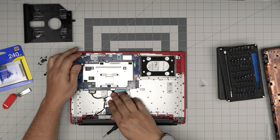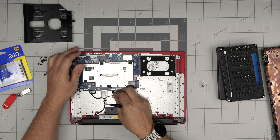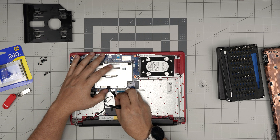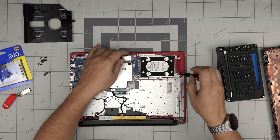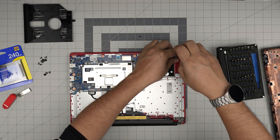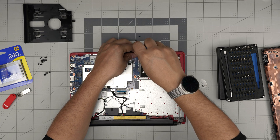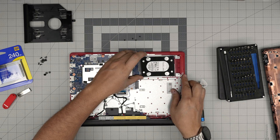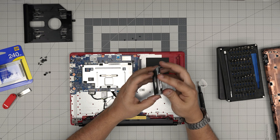To remove the hard drive you do not need to disconnect the battery — it's absolutely not required. But if you want to, just pull this jack backward to disconnect it, and to put it back in, go straight inside the jack and pinch it in. We're going to remove the four screws holding the caddy for the hard drive — the bracket that holds the hard drive in place. Remove the four screws, then slide the hard drive to the side and the whole thing comes out.